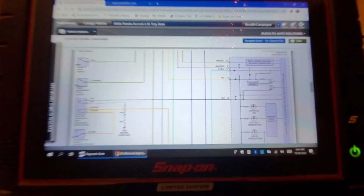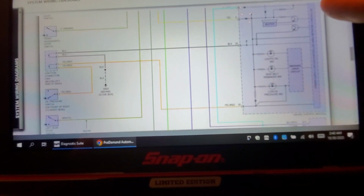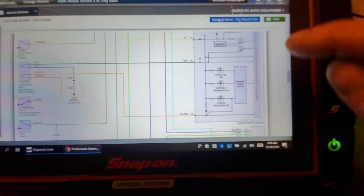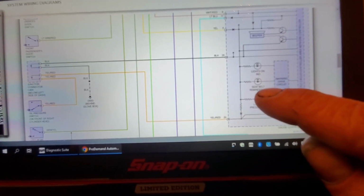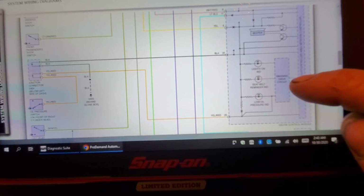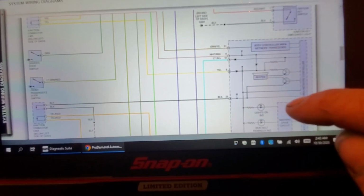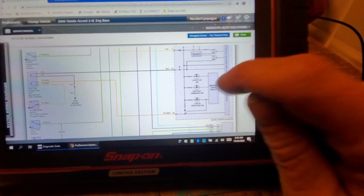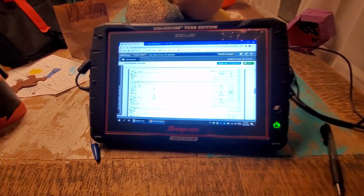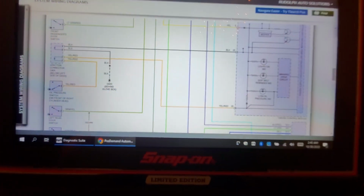All right. Under warning systems. Yeah, warning systems. Look at it. Look what it says here. Gauge control module. What are we seeing? Lights on indicator. Seat belt reminder indicator. Warning drive circuit. Beeper. You see what I'm seeing? Low oil pressure indicator. That baby lives in the IPC, I'm sure of it. So there you go. I hope that answers your question.